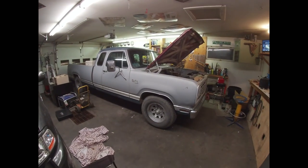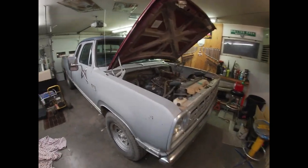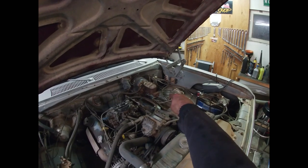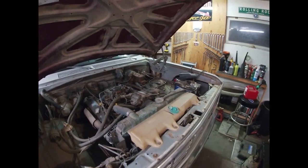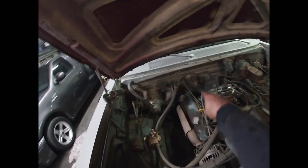I've got something in here that I don't generally get to see - an old Dodge, I believe this one's a '76, got a 440 in it. Basically it's a no-start condition; was running, quit running. These are incredibly simple with the exception of the ignition control module - the igniter module or whatever you want to call it - which is pretty prone to failure in these.